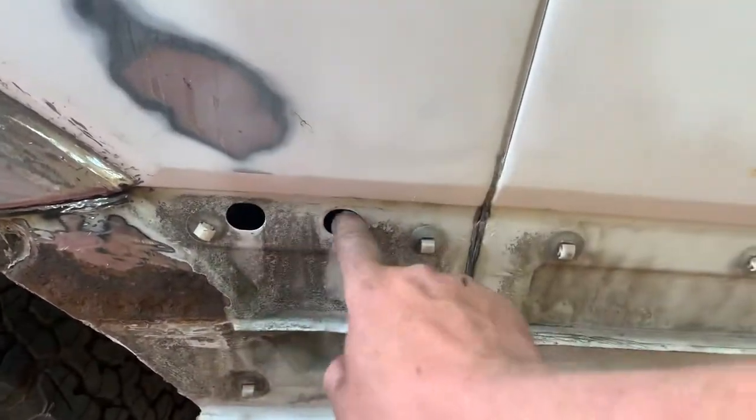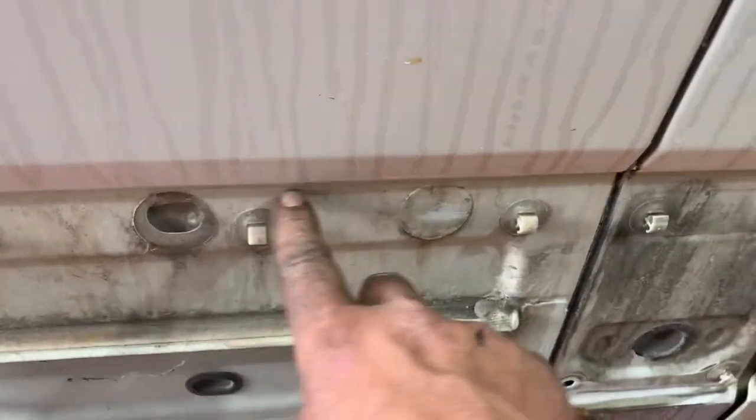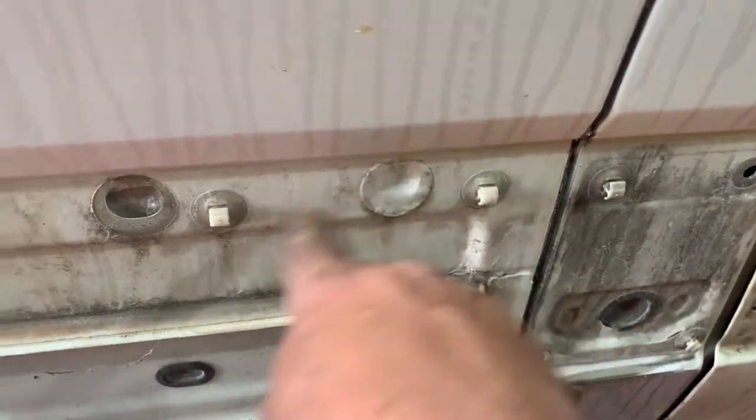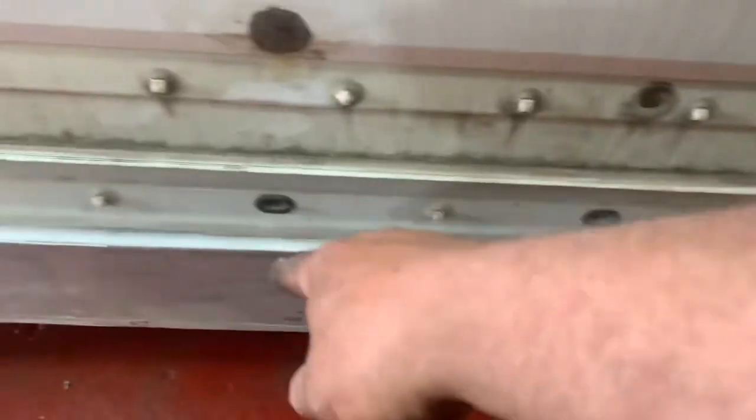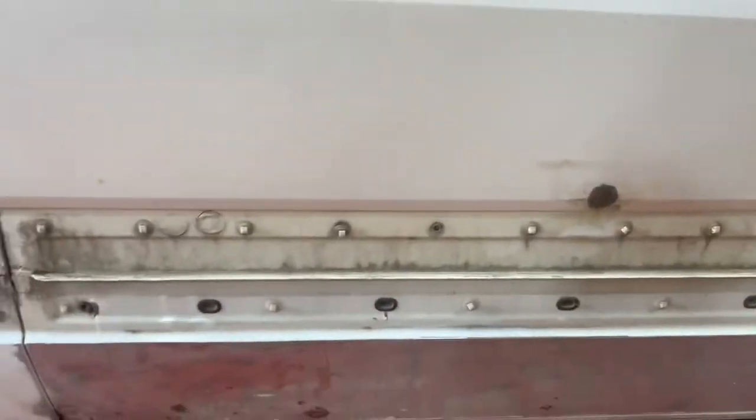They put these stupid holes in, Mercedes do, and they have a little piece of sticky tape over the top. Look, stupid idea that is. Rubbish. They break like that. And then the water runs down the side of the van, goes in there. And if the drain holes and the seals aren't brilliant, fills them up. So that seal had about 5 litres of water in it.